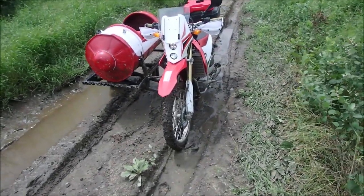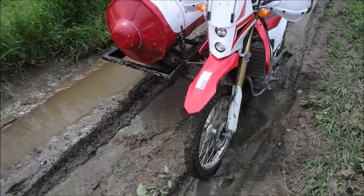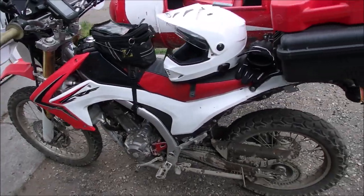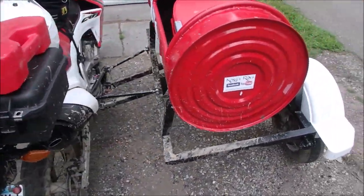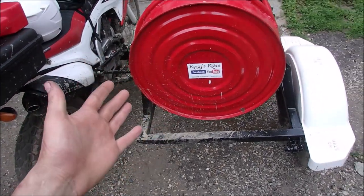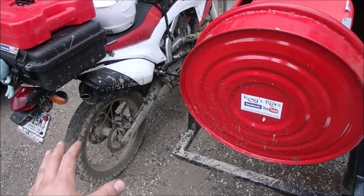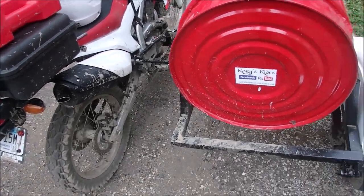Well, I got stuck. The track width was just the right size and I got wedged, so I kept trying to lift the sidecar up out of there and slide the bike over. Okay, so the sidecar is now all set up. Got the alignment fixed. The big bore kit makes this way more enjoyable. I could probably go up a few teeth in the back but I'm nowhere near needing the 47 tooth rear that the 250cc engine needed.